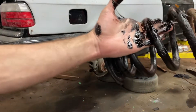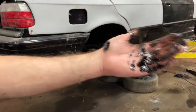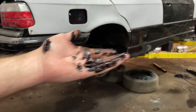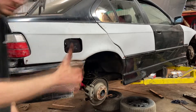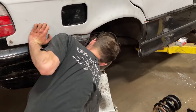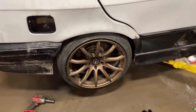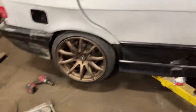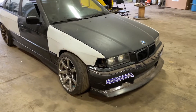Whoever owned this car — oil spray does not mean just spray a bunch of oil all over your car. It looks like somebody just sprayed 10 gallons of oil underneath it. Here's a pro tip: if you're putting shocks on by yourself, tighten it up to max preload and then sit on the caliper. In the air unloaded it's not too bad — a little high, so if it drops down from this that would be perfect. I'll leave it at this height, do the other side, and then put the fronts on and get the car on the ground.